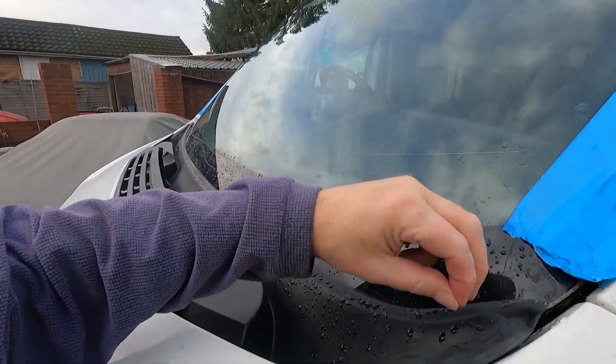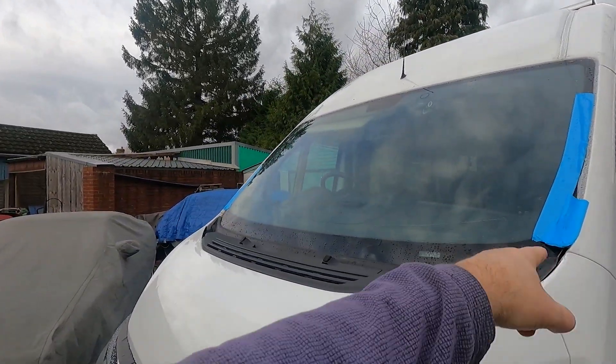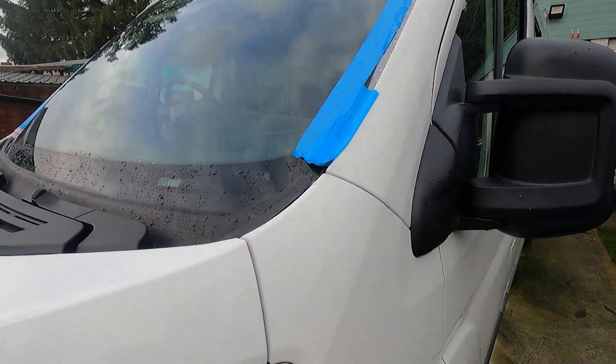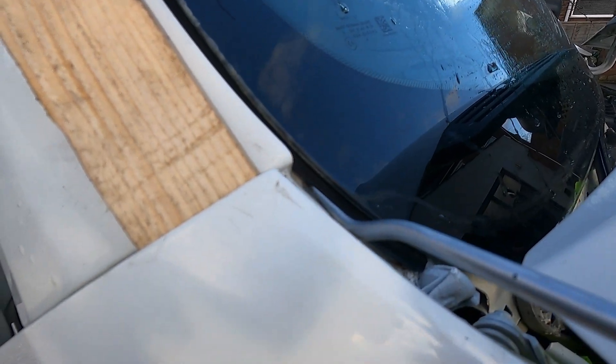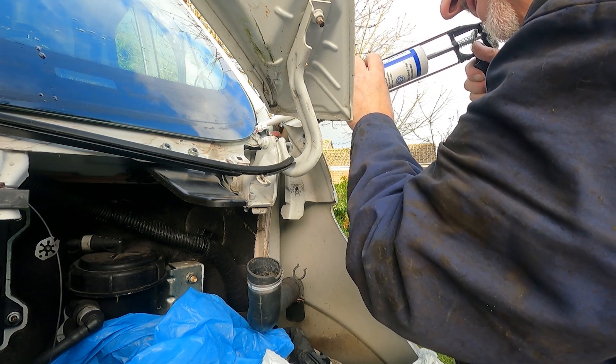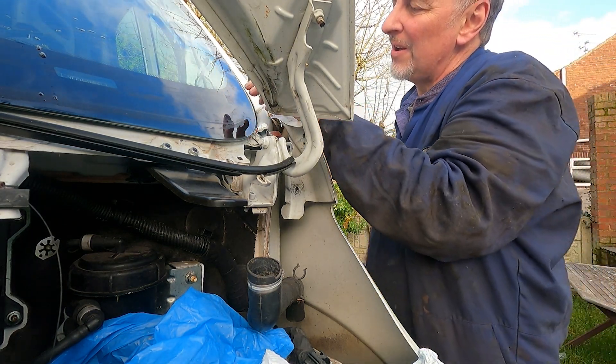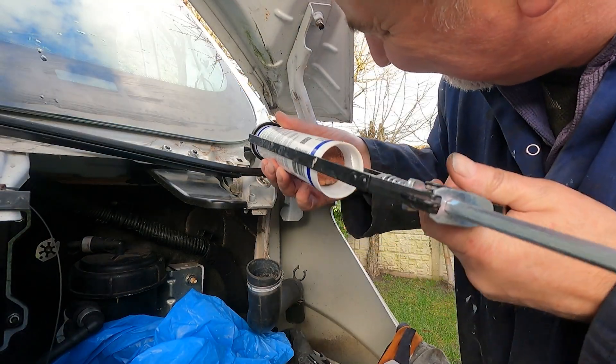From those little experiments we've found that rainwater is coming into our van from the windscreen into this part of the bodywork just here where the scuttle panel is. We know it's probably not the glass around those areas, but it might be the glass here or it might actually be some joints hiding behind the wing. Underneath that rubber seal layer where all the water comes down, you can see that seam — and that seam was unsealed. So by prising back the black rubber seal I could easily pump in a quantity of sealant. I unbolted the wingtops and prised them back slightly, which made the job a little easier.